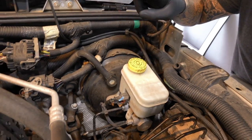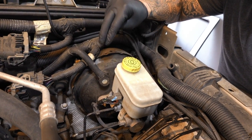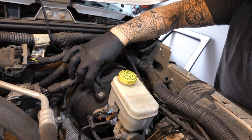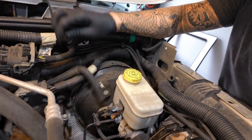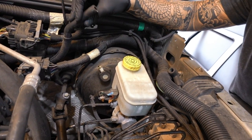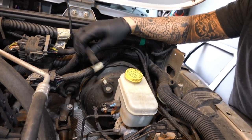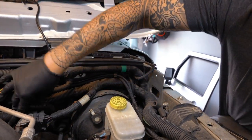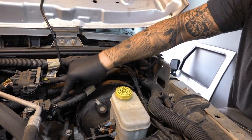We've got the brake master cylinder we're going to need to disconnect from the booster. First thing we want to do is take loose the vacuum line here. All you've got to do is just twist it and pull it right off - simple. We're going to move it back. You're going to want to inspect this line to see if it has any cracks or anything like that. This one's still good, even with 207,000 miles.